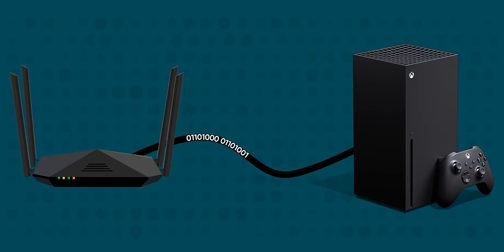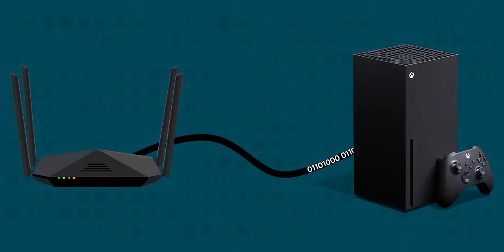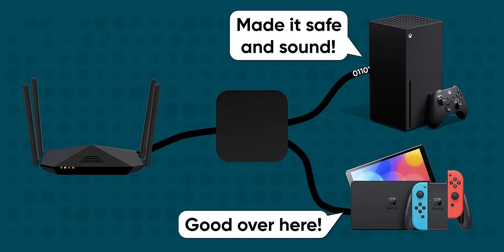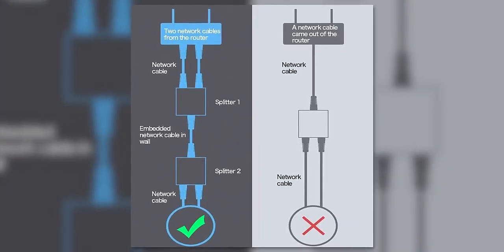By contrast, a network connection is digital — which is still just electrical pulses on a wire — but it's different because the ones and zeros are flowing bi-directionally as the connected devices communicate with each other. So back to our garage: if my router sends out a data packet, it expects to receive confirmation that it arrived safely. So if I had two devices hooked up to that port, it wouldn't know what to do with it. With that said, the diagram on the product page for this isn't entirely unreasonable — there are enough conductors inside a modern Ethernet cable to support more than one physical connection.